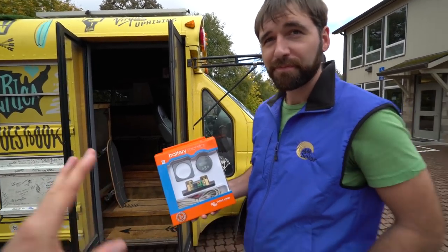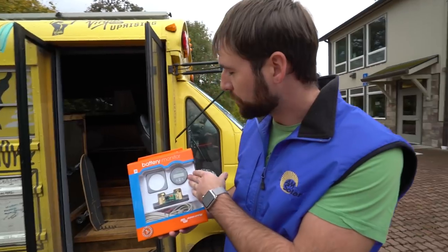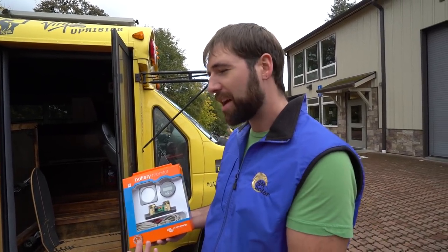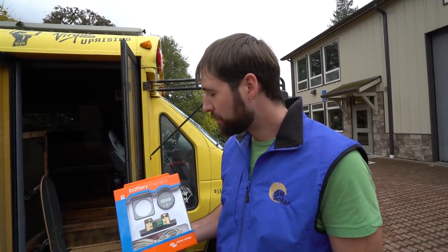Once you hit the 50% mark, or 12.2 volts, that is when they start to degrade really quickly. And unfortunately, Jax's batteries are at the point of no return. So we installed a couple of new batteries with a little bit more capacity. A couple of nice features about this: it's got Bluetooth, so without even getting out of bed in the morning, you can pull your phone out, flip open the app, and see the state of charge, battery voltage, and net current — whether you're generating power from solar or losing power from loads. The main thing that's really nice is the percentage — you wake up and you're like, I'm at 90%, I'm good to go, or I'm at 60% and need to get something charging right away. Basically, if you don't know the percentage of battery capacity, you could be like me and ruin a $700 battery.